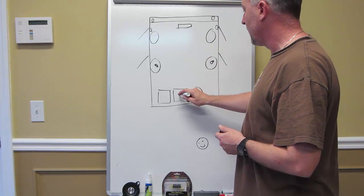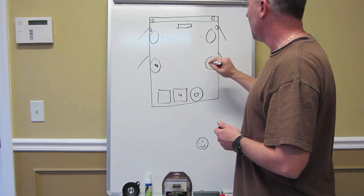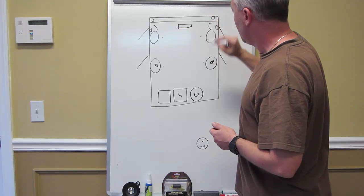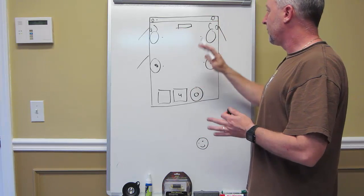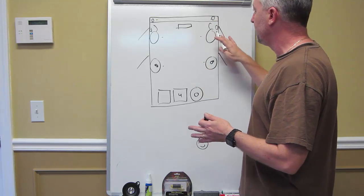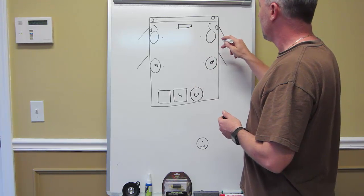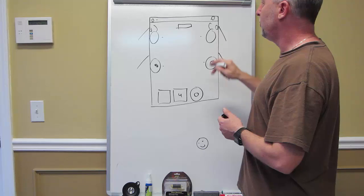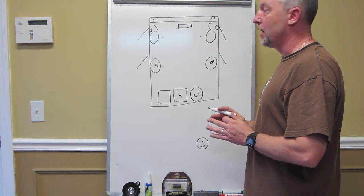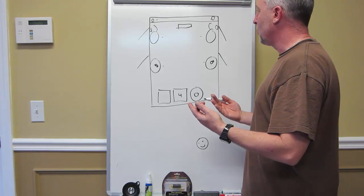Now, he's got a four-channel amplifier, so he's got power in front, left and right, rear, left and right. These speakers are also in parallel to the fronts as well. So here's what happens. The factory head unit was fine when it only had a mild 15 watts of power. All the speakers played fine, no problem. When he got a real amplifier and started to put 120 watts RMS into his front stage, these speakers started distorting wicked as soon as he puts the radio beyond 5. So he's not enjoying what he could be had he had it wired a little bit differently.